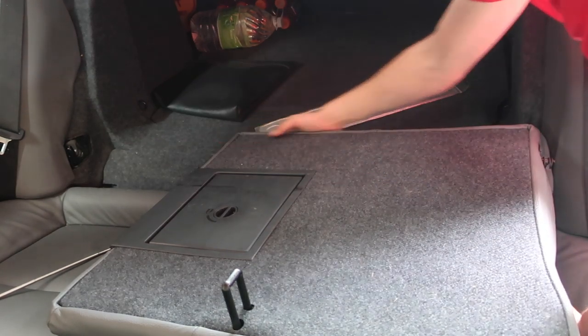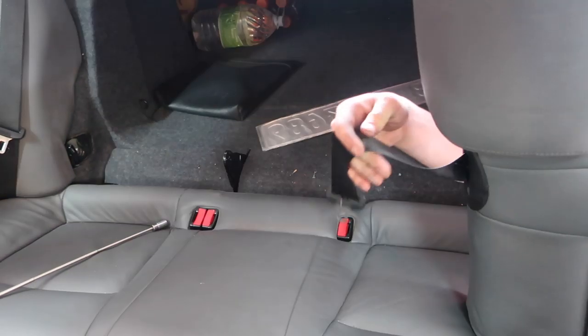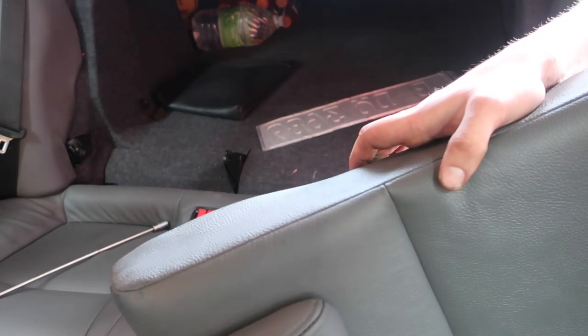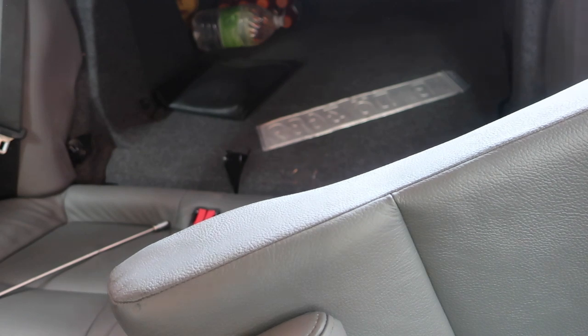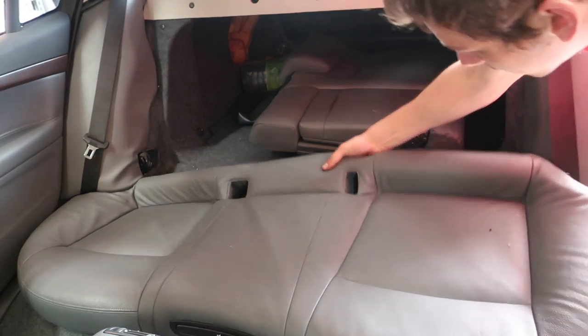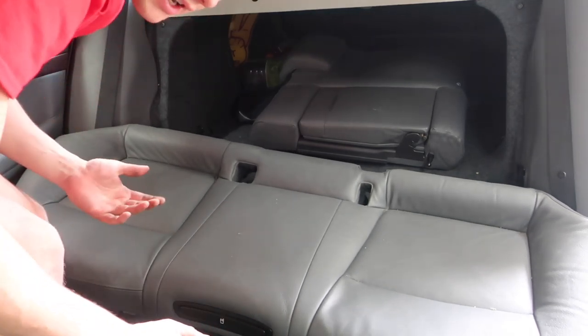That one's out. It's also connected to a little frame in the middle, so you just have to pull the pin out of that and then you're good. You're also attached to the seat belt here. While that's still attached, I'll grab these couple pieces and throw them in the trunk while I take the bottom cushion out. To remove the back bench there are just two pretty big metal clips — one here and the same spot on the other side. The way to get that out is just to reach under there and rip it out.